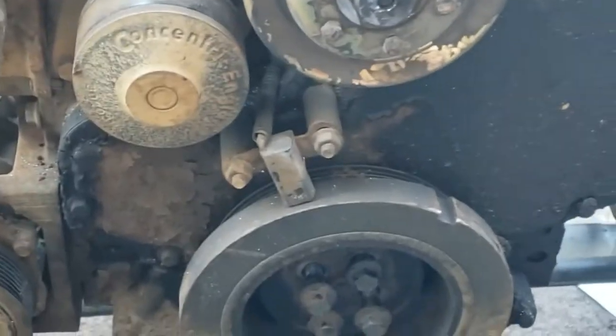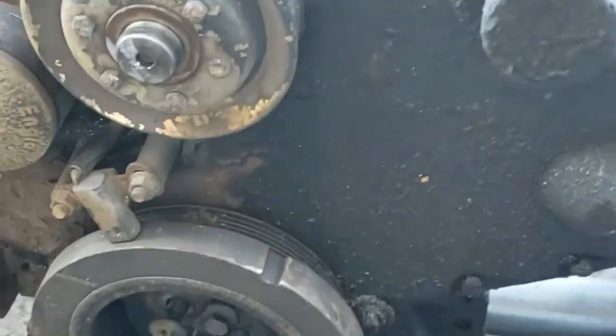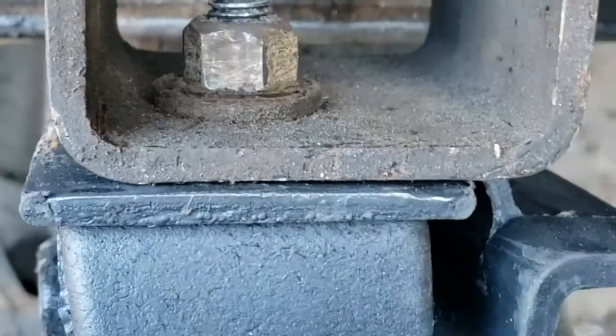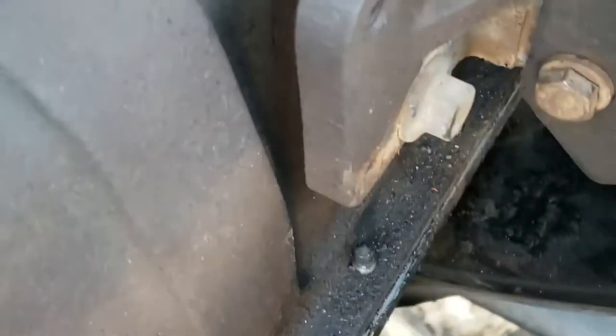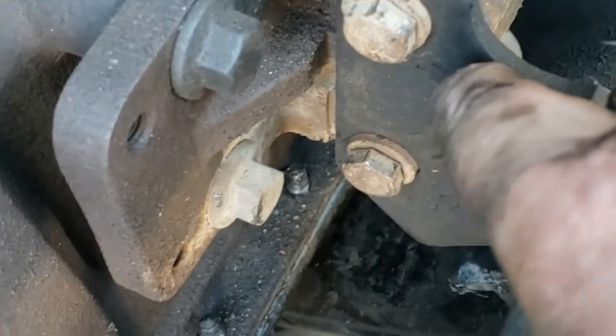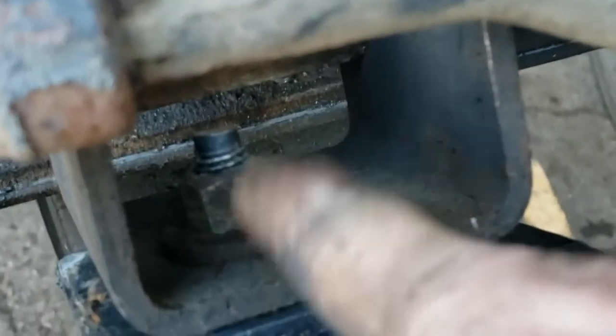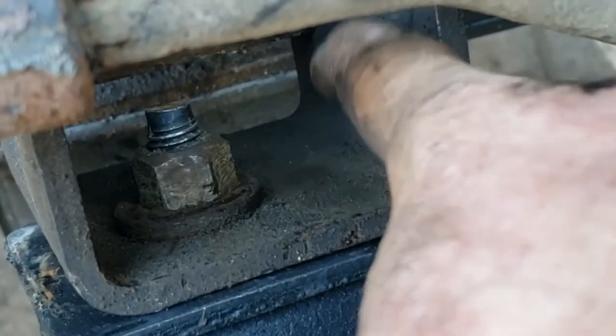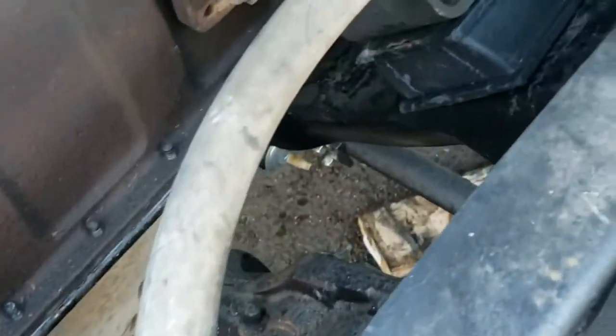All right, we're back on the Dodge again. What I got done since last being here was I got motor mounts in — didn't think that was that big of an issue. They are slightly crooked, but when I did it on my truck I basically had to swap this bracket side to side because the hole in this bracket is offset and the hole had been up here and it was not lining up to my crossmember. I don't know whether that's just due to things having been different — my truck, different years.